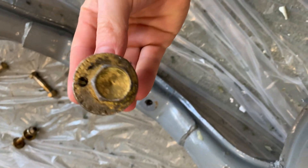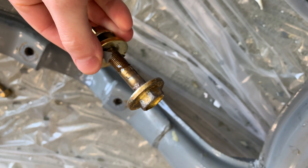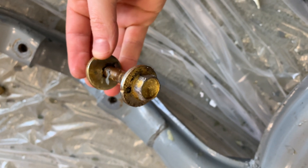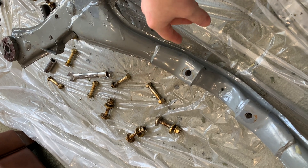For a while I was convinced I should run eccentric bolts because you can adjust the camber and toe curves a little bit and find this super perfectly ideal setup. But unless you're running FD — where you can't even reinforce your subframe anyway — it's kind of pointless. It just over-complicates things and those things can loosen up and move on you. I had all this hardware re-zinc plated. As you can see, it's not very durable — it tends to come off and basically flash rust in my garage.